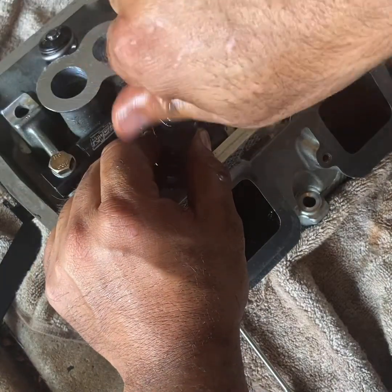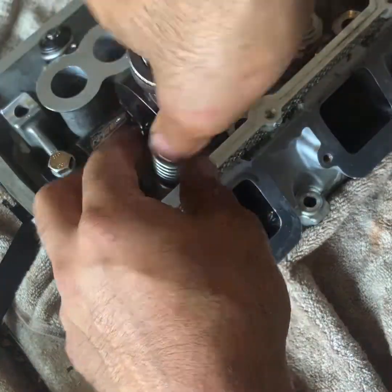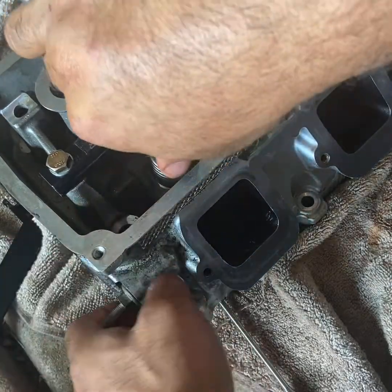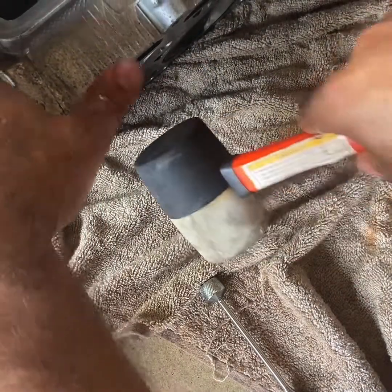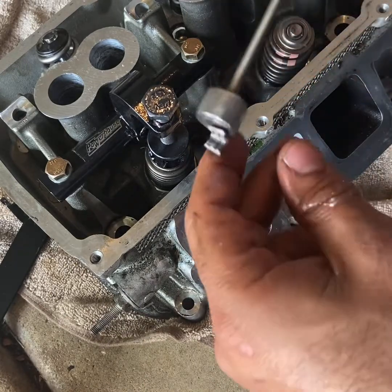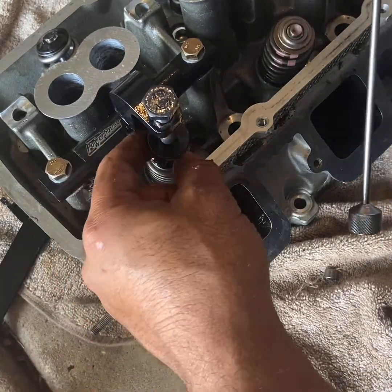What's up YouTube, just want to show you guys real quick — I installed my pack springs, the whole kit I bought from Jay. It came with pack springs, chromoly retainers, chromoly valve seats, and a number 6070 shim which sat on top of the OEM shim. It also came with hardened pushrods and the cam. The cam is a pro charger cam — 205 by 226 — it doesn't chop. It's kind of a stage one or stage one-and-a-half pro charger cam.